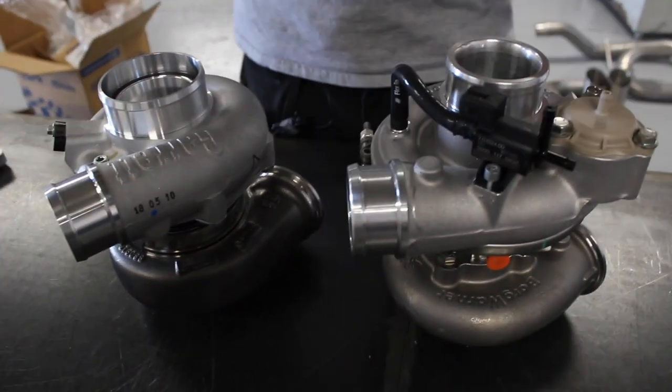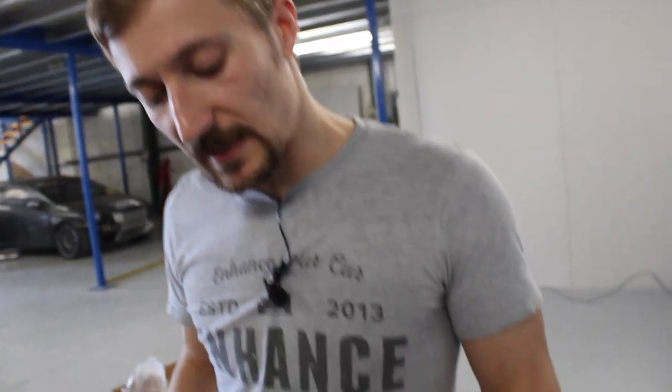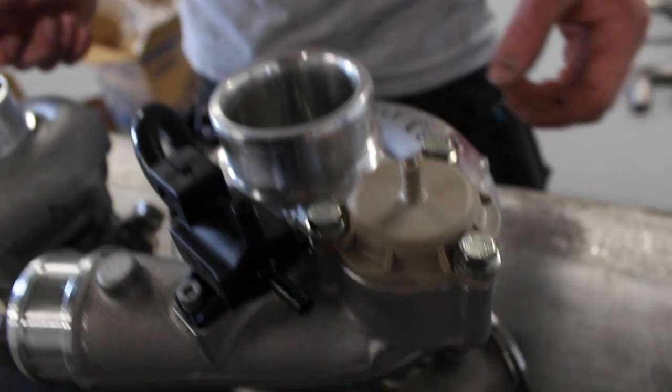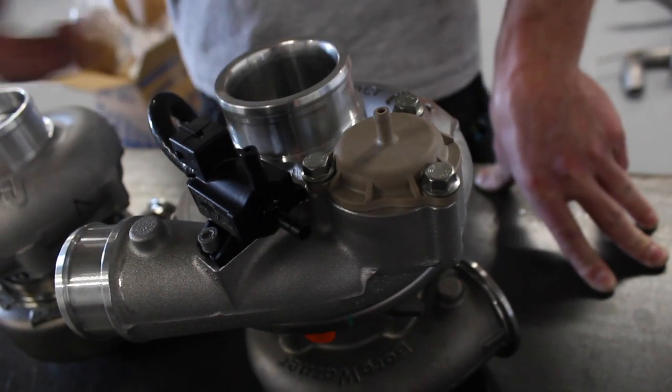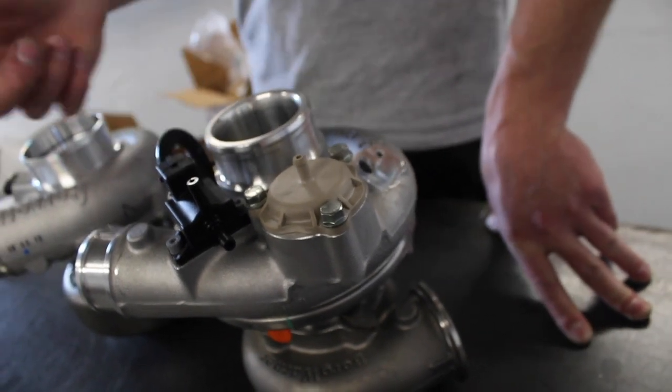Looking at the compressor wheels, they are very different — it just comes down to really complicated aero compressor tech, but they both work really well. The EFR has a recirculation valve built into the outside of it, which is a really nice feature, and the boost control solenoid as well — a really nice feature that makes it a lot easier to install. On some setups you won't use that; you might use an external four-port boost control solenoid or want a big blow-off valve, but it's there if you need it.